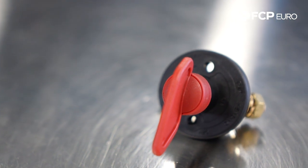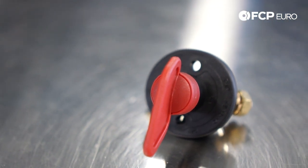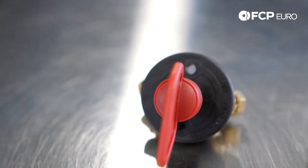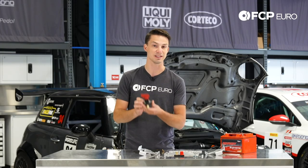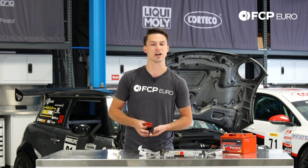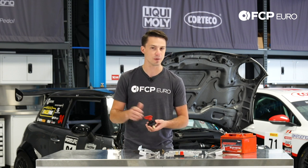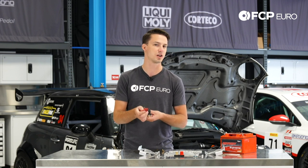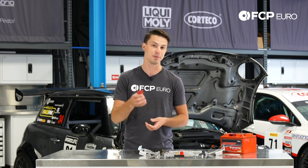So this is the basic Sparco kill switch. We're going to be wiring it in this car to basically be a race car kill switch, which is going to kill the engine when you turn it off — this is in case of emergencies, a crash, something of that. The other thing you can use this as is a battery kill switch if you're storing your car for a long time. This will allow you to turn your battery off to make sure your battery doesn't drain.